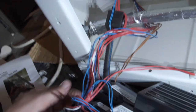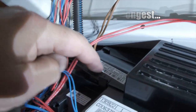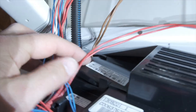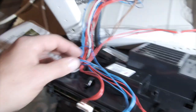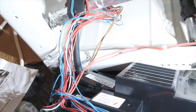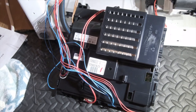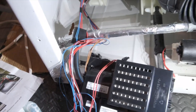I cut all the tape away and pulled everything apart. The ones on the outside come off pretty easy, but the big fittings in the middle were kind of hard to get out without the right tool. I used a really tiny allen wrench and that helped a little bit. They send you a schematic which shows exactly where to put the wires back and plug everything in — that was very helpful. I also took pictures of everything before I unplugged it so I could reference them when putting everything back. Everything's plugged into the new board in the right place — now I'm going to tape up the wires.